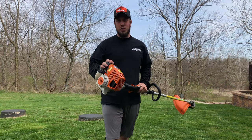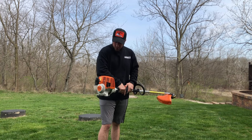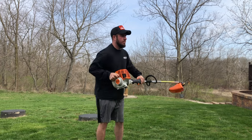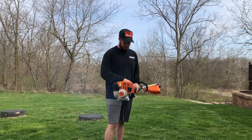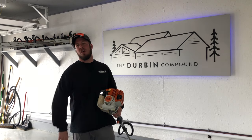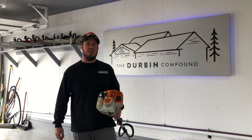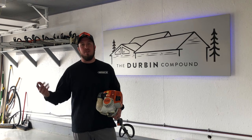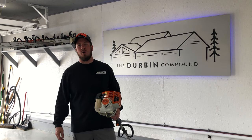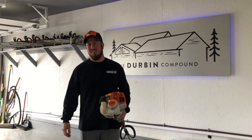Alright, so always remember when working on small engines: air, fuel, and spark. We've got spark now so we're going to go ahead and give it a shot — start this bad boy up and see what it does. Alright guys, not the perfect video, but definitely a real-time troubleshooting of a trimmer that doesn't start. I got the coil replaced and got it going. I'll need to put another tank of fuel through it to get it running very well and clear out any fuel that was gummed up in it. If you left it for a year or two years, you're going to have more problems. I hope this helps somebody — give me a thumbs up or thumbs down, and we'll see you guys in the next video.